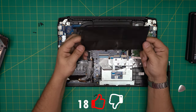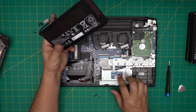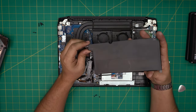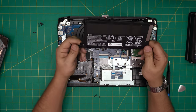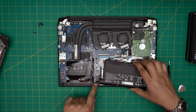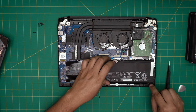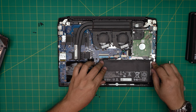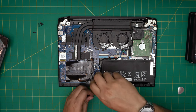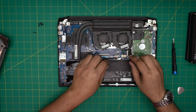When the battery starts inflating, it pushes toward the trackpad and forces it outward — so you'll definitely want to replace it. If you have the new battery, align the small pinhole on the battery with the pinhole in this corner, bring it down, and then put the screws in first.